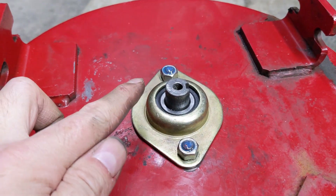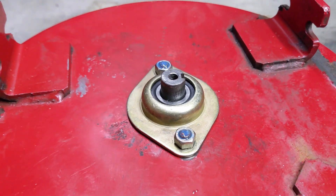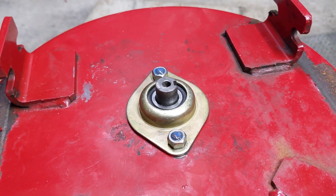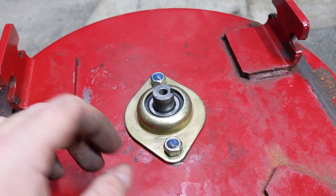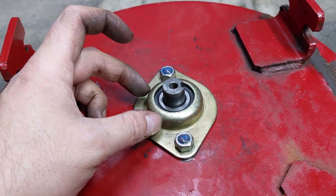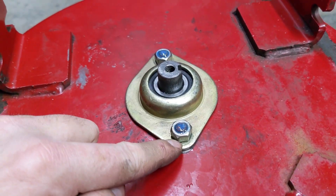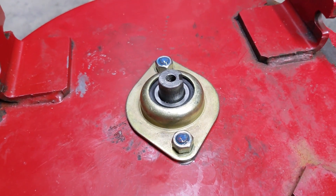I've used some blue thread locker with some new stainless steel nuts. I'm not using any washers because the manual doesn't call for washers here, and when it was disassembled there were no washers underneath the original nuts. In fact there was only one nut, and when the bearing seized and started to damage the bearing flange, one nut backed off, which caused the whole thing to rattle more, which then backed off the other nut. So two new nuts with blue thread locker will take care of that.